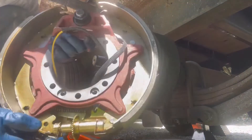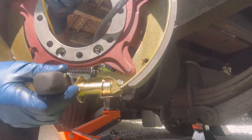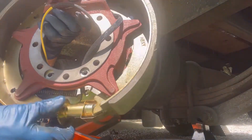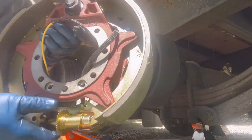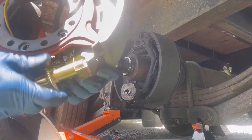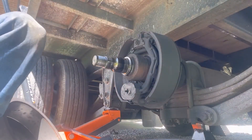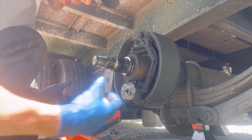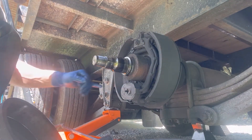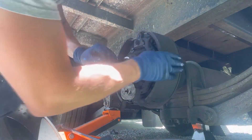Here's the new set of brakes I'm putting on. You've got to take that stubby right there and work those teeth to shrink it down — right now I'm making it bigger. There's a finger right there that stops it going backwards. Usually you've got to shrink it so the drum comes right off. These actually look much better than I thought — still got some meat on them.